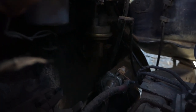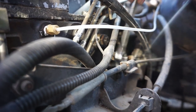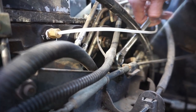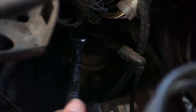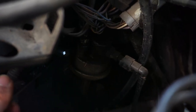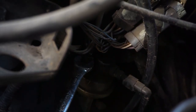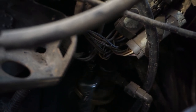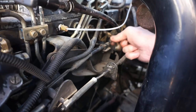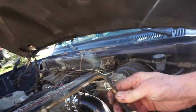This install starts at the right side of the engine block, where we can see the old lift pump. We're going to start by removing the banjo bolt connected to this fuel line, and then on the other end of the same fuel line at the lift pump, we're going to remove the fitting. It's a bit of a struggle to do this with one hand, but I had to hold the camera. Then we can simply pull this line out of place.